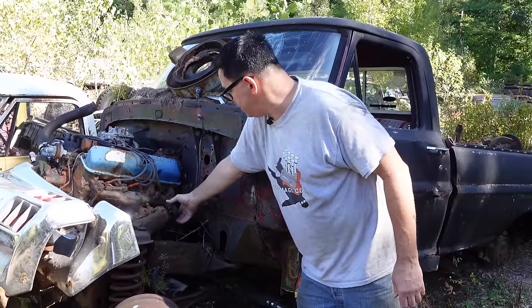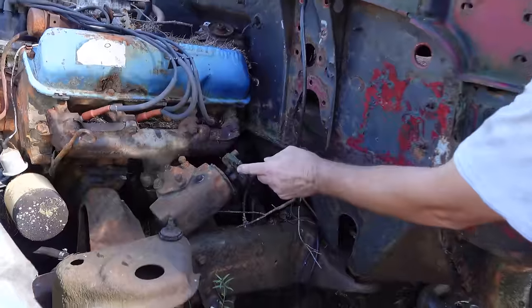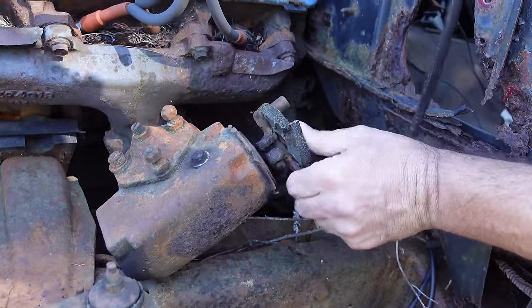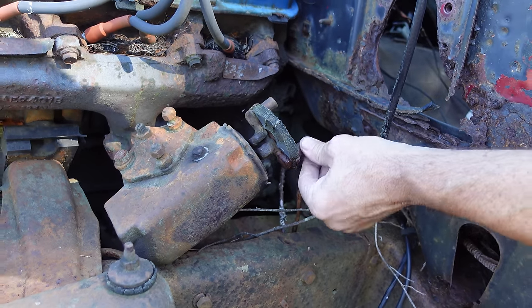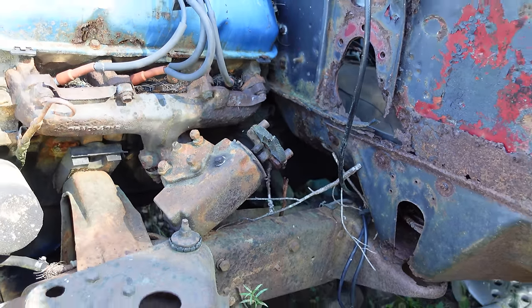Manual steering on this one here, and here is the fabric coupler right here, which was also used by General Motors, but when these things get played out, you get a sloppy steering wheel. Theoretically, this was here to prevent vibrations from getting into the cab, but kind of weird, the fabric coupler right there, the steering column would go into that. Now let's take a peek here.